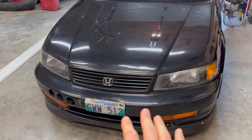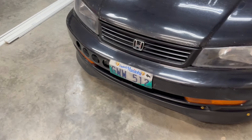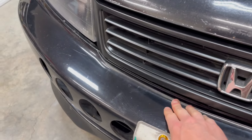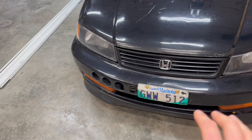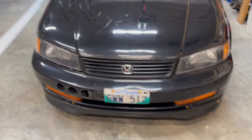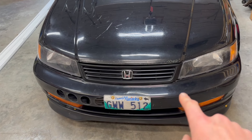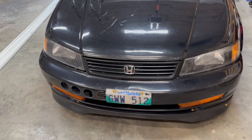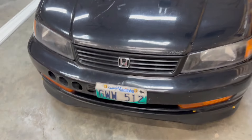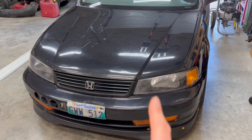Alignment I still need to work a little bit more on. I had to redo some of the fasteners and the fenders to make it work. I also want to do some fastening here because right now there's no crash bar in the front, which is where the bumper would normally mount to, and that's no longer there. So I have to do something to make it a bit more rigid in the front so I can get the alignment under the headlights figured out and close the gap between the grille and the bumper. That's cosmetic stuff — I don't care too much about cosmetics right now. I just want to get this thing running.